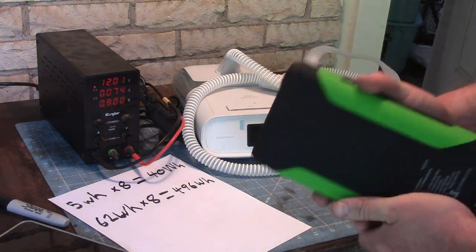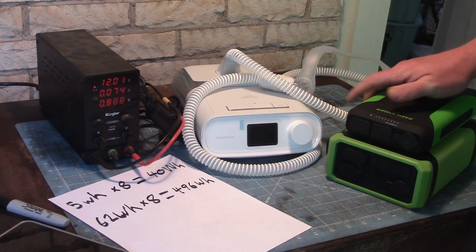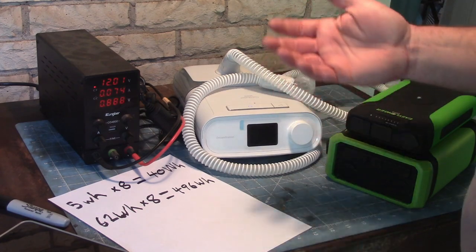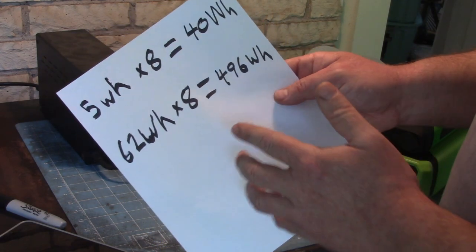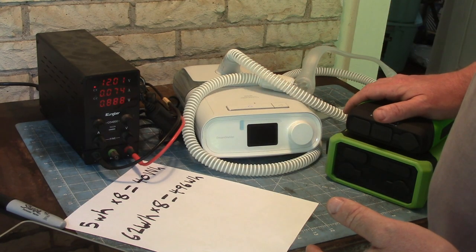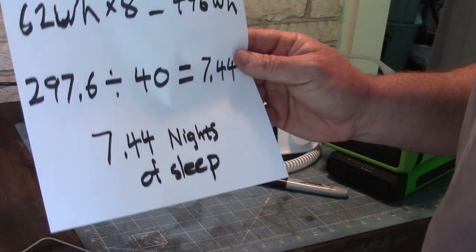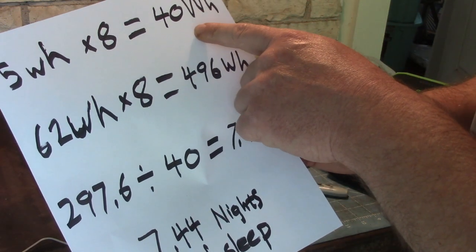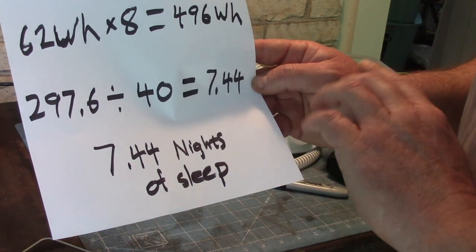So you'd have to have a massive battery if you wanted to use heat and humidity during a blackout. These units are both around $300 each — together they could get you through a night. The average price of battery seems to be around a dollar a watt-hour, so one night would be about a $500 battery and two nights about a $1,000 battery if you want heat and humidity. When you're camping, just don't use it. If the power goes out and you have one of these battery packs, just turn the heat and humidity off and disconnect it if you have a DS-1. Using the bigger battery pack as a reference — 296 watt-hours available, using 40 watt-hours a night — that means we get 7.4 nights of battery backup with no heat and humidity.